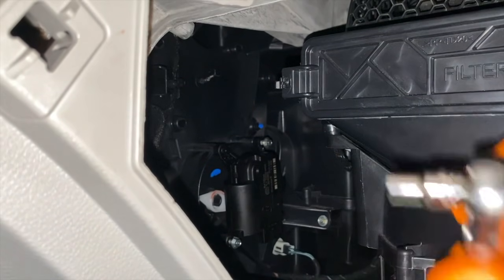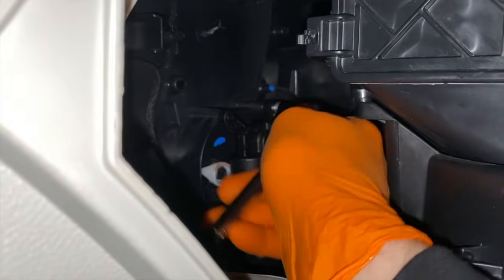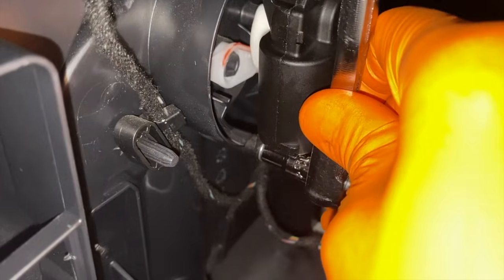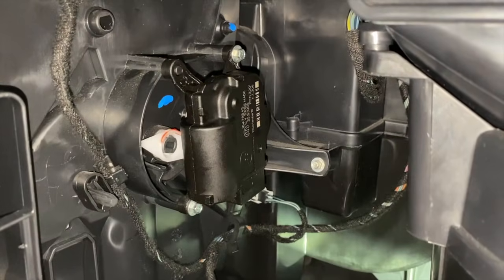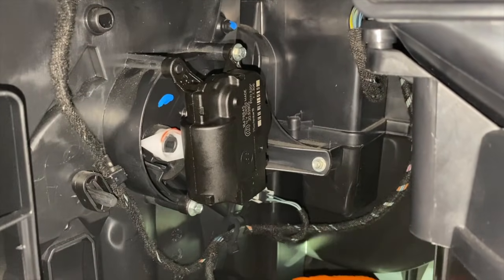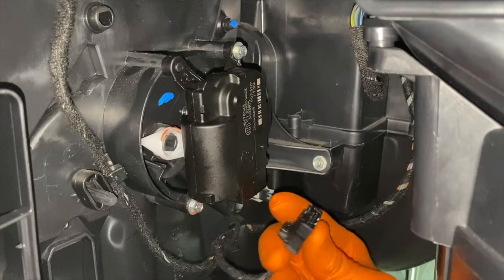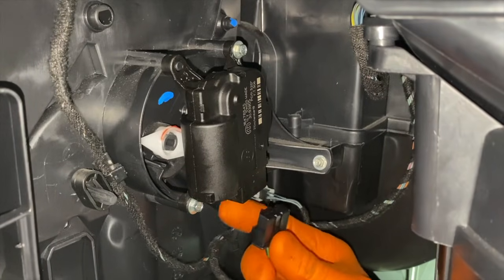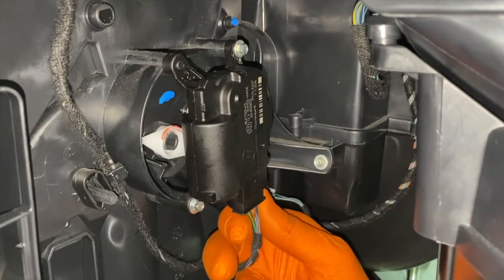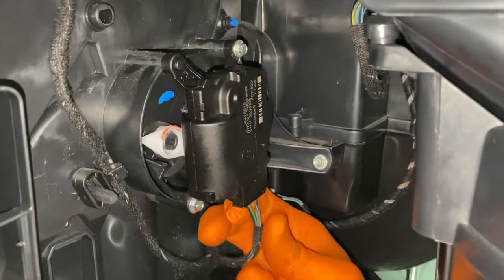From here, I'll grab the ratchet. Again, you want them snug, but do not over tighten them. They're plastic, or the inserts are plastic. DIYers, we're making progress. Both upper and lower 7/32 screws are properly secured and the mount is properly positioned. And from here, I'm coming down below and the electrical connection point. And there is the back side that is going to go on the inner side here. Align it properly. And again, stay away from the wires. Push up until it is locked in place, as shown here.